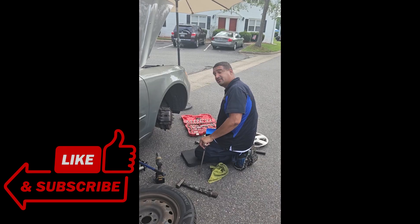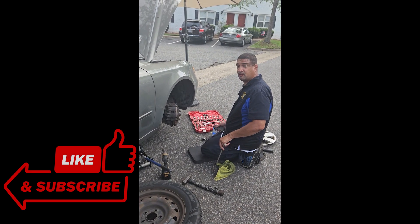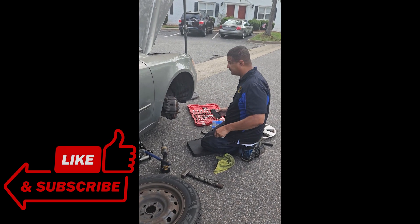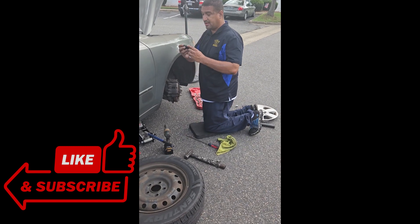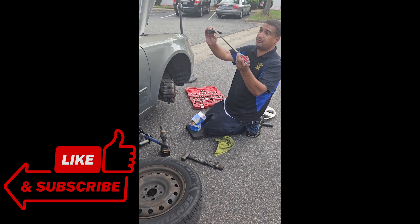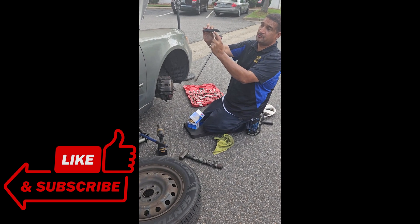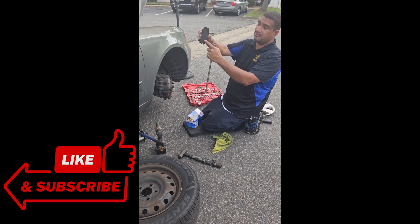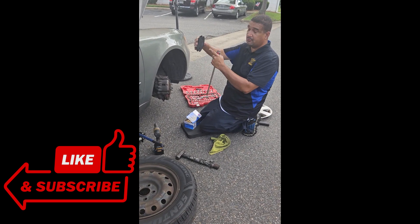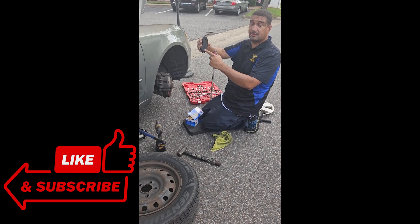We'll cut it off. My name is Miguel from Mobile Mechanics 757. I'm here to educate this customer about brakes and what will happen if you do not change them. I'm going from a $100 job to a $300 to $400 job. If you look at this brake pad — this is a brand new brake pad — you're looking at the thickness like a steak. This part right here is just part of the brake pad itself; it keeps the noise down when you hit your brakes. That's the difference between a cheap brake and a quality brake.